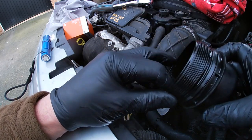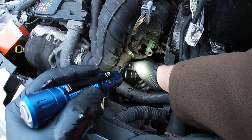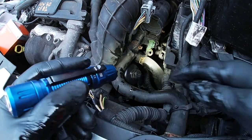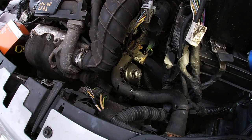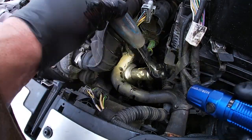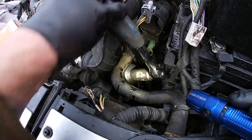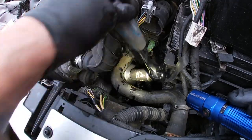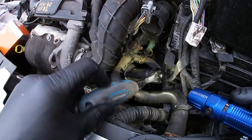It's lubricated with a little bit of oil. Be aware — apprentice truck fitters — some of these caps actually have thermostats in them and they need to be checked. When you screw it in, you can feel when you get to the rubber; this is when you can then use a tool. I'll put the 27mm socket on there and wind it up. It says 25 newton metres on the cap — if you're unsure, always use a torque wrench. I roughly know what 25 newton metres feels like — it's about the tightness you'd do up an M8 bolt.